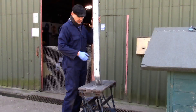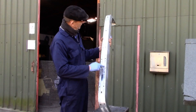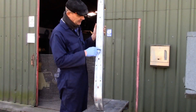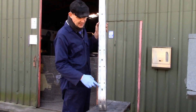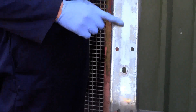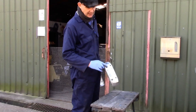Here's a rear bumper. You can see the two main fixing bolts to the car, and then 22 of the fixing holes for the rubber, which once it's sprayed will look pretty naff. Also note where the salt water has sat over winters — we get a load of oxide building up particularly on the bottom edge. I've already started trying to clean these back beyond the oxide. Some are slightly nasty and going to be really hard work, but I've taken it back to a little bit of thickness of metal so I think I can do it.